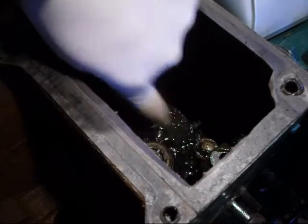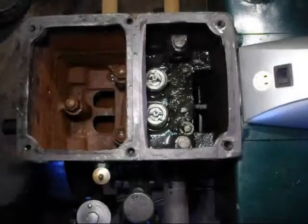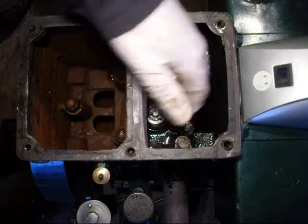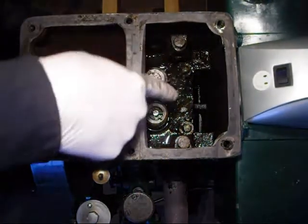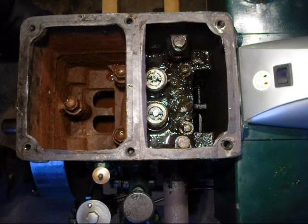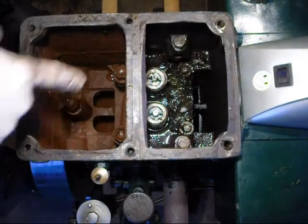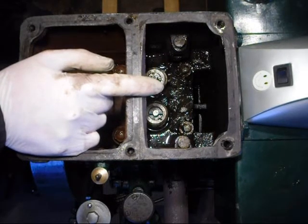These are the next two head nuts — they're just standard ones. We're going to remove the head now. I also removed the valve caps which sit on the top, protect the little pin, and give the rocker something to press on. Now we're going to remove the five head bolts. It's important to release them evenly — this might be cast iron, and twisting is more of a problem on alloy engines, but it could still be a problem here. You might need to use a bar, but don't apply too much force.